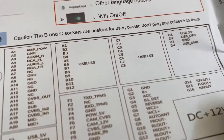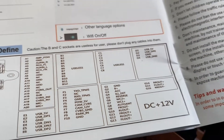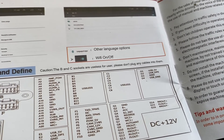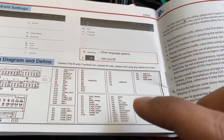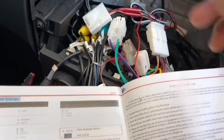If you have your manual for the head unit you'll see something similar. There is WC1 and WC2, labeled G6 and G7. Those G6 and G7 are what you'll be connecting with the gray and white wires coming out of this unit. The gray and white connect to WC1 and WC2, while the red and black connect to any 12V wire — I'll show you where I connected those.